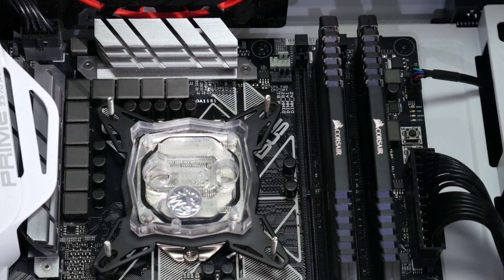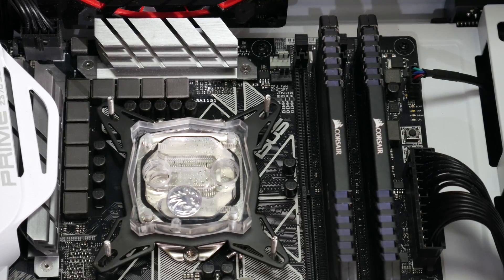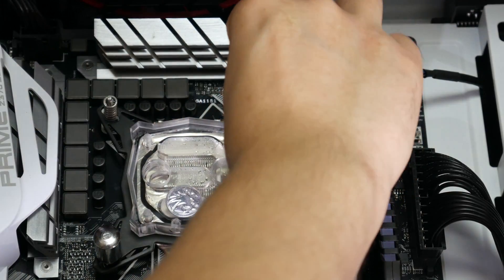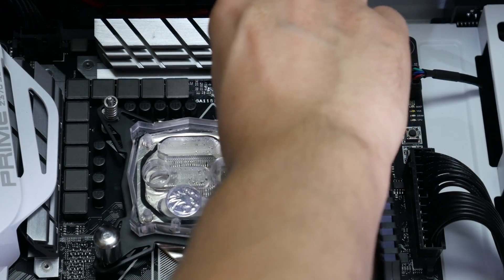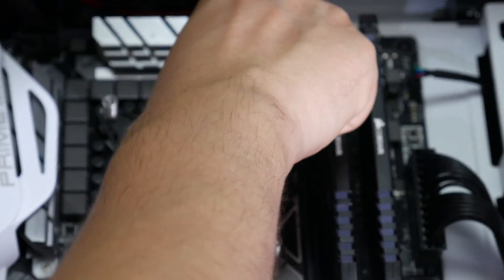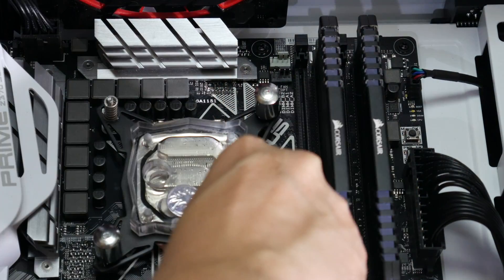I haven't done any thermal testing yet but it hasn't leaked. I've had a lot of this stuff on the bench for a couple of weeks running water through it — no leaks, so I'm happy. Nice and easy to fit, comes with a nice backplate. Now one thing I like to do when screwing on CPU water blocks is always alternate the corners, giving a few turns at a time. This way you're not putting too much pressure on any one side or making it buckle.